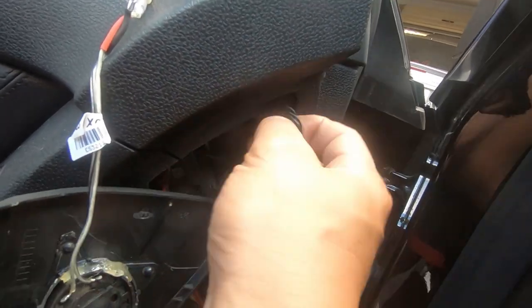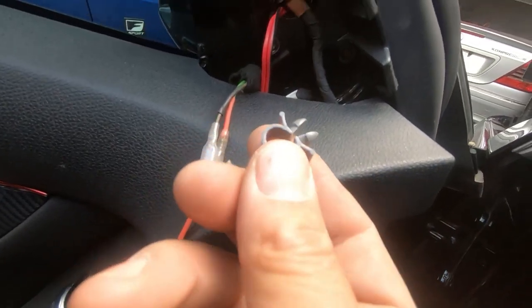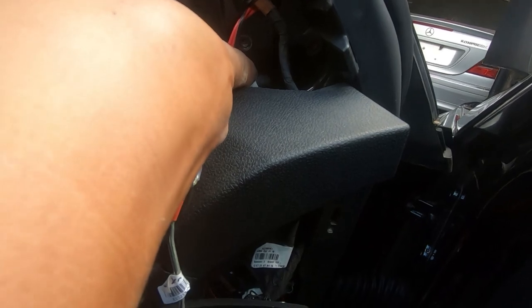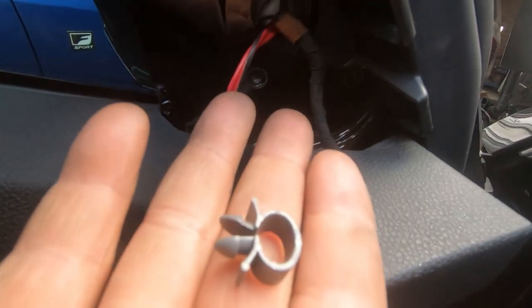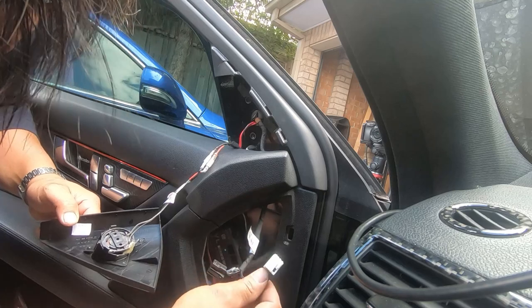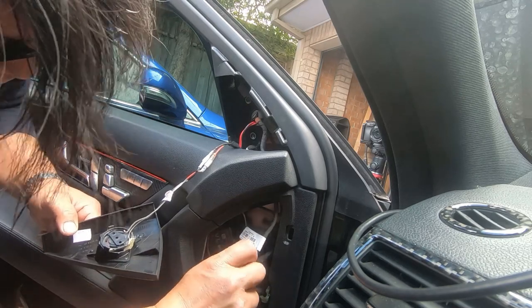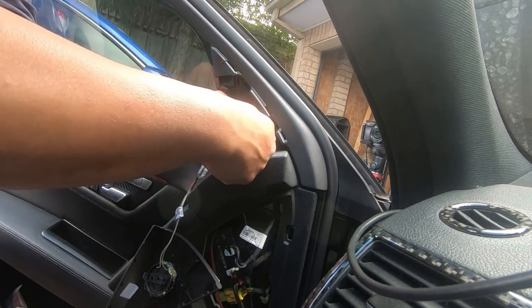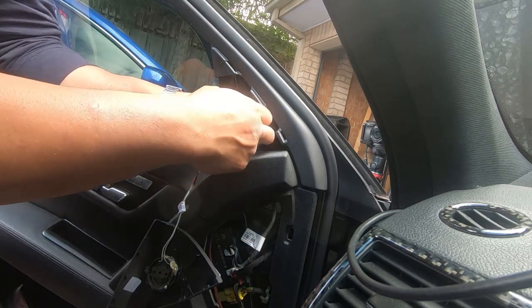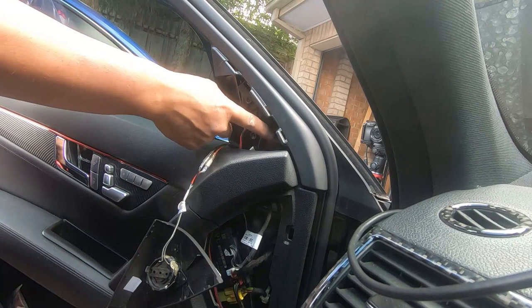Feed the cable through the bottom. Grab your cable clip and clip back the two wires as they were originally. There's a tiny little hole where this clip goes back in. Now that we've run our cables back in, plug them back in — white to white, black to black. Follow the color codes and you cannot go wrong; they only plug in one way. We get the cable clip, put it around both cables just like that, and push it back into the hole.